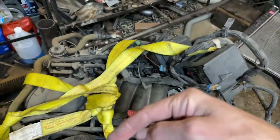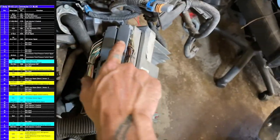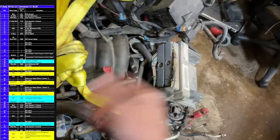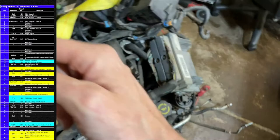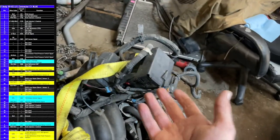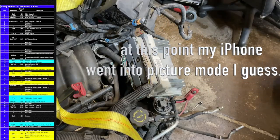lt1swap.com — I'll put it in the description below — has a specific wiring pinout diagram of these connectors right here for every year that you can get an LS out of, at least the ones I care about. When you open it up it'll tell you pin 1 all the way to 44, and then 45 to 100 or whatever, on each connector. It'll tell you that wire is yellow, you can pull it out, it's for this — and you just go down the chart, literally one wire at a time. It's going to say this wire is needed, do not remove it; this wire is for that; that wire is the ignition. What you're basically looking for is anything it says you can remove that you're not going to use. That's also an important key — if you're going to use AC then don't delete the AC, if you're going to use it don't delete it. But as you're going down that list, if you have no intention of ever using it you might as well just delete it from the wiring harness.